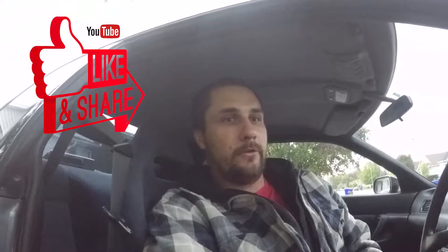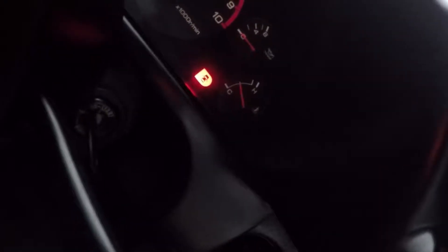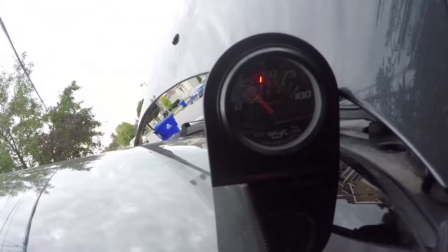If you guys are running into those problems, definitely pick up a cheap mechanical gauge — this one's from Canadian Tire, but in the US or elsewhere you can get them on Amazon for $10–$15. It takes about half an hour to install and helps you diagnose whether you have an oil pump issue — which could be thousands of dollars — or just a simple oil pressure switch. We're not out of the woods with this car — collection cars take a lot of time and money. Temperature is at temp, showing 22 psi at 1000 RPM. Thanks for watching, subscribe if you want to follow along!